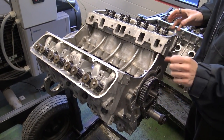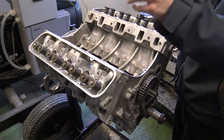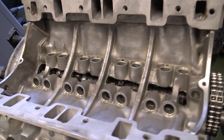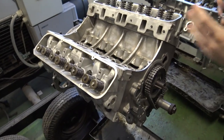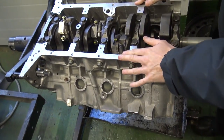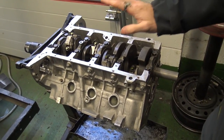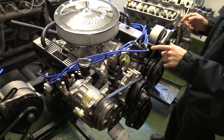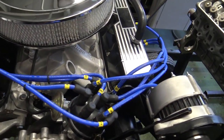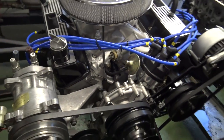Holly's getting on really well with the engine for the MG - 3.5 litre. We have standard cylinder heads, fully re-manufactured with new valves, guides, seals, and springs. We're on composite head gaskets. The camshaft is a hyper torque max on a 3.5, so lots of bottom end grunt. We've also got a 4.6 bottom end being built up for a P38 Autobiography that we'll have for sale here very soon. Additionally there's a 4.6 stage 3 engine - fully dressed - going over to Mauritius for a Defender 90, complete with our Edelbrock 500 CFM carburettor setup and the RPI ignition kit.